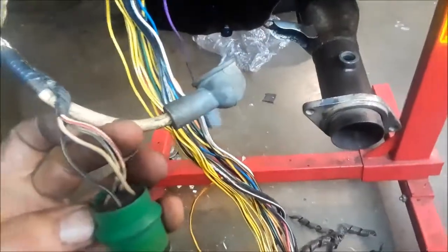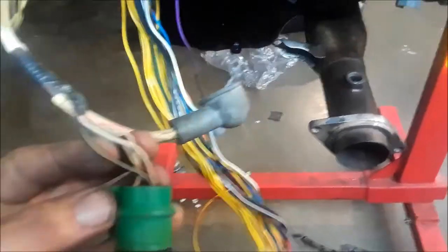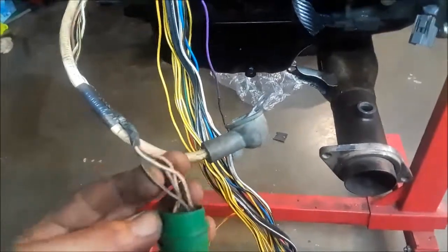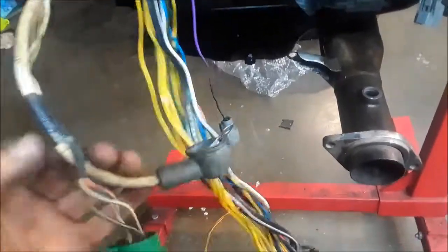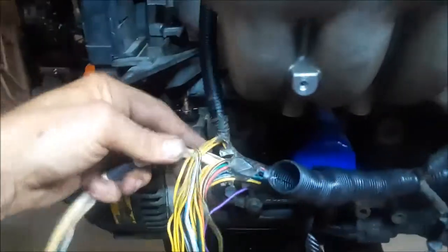You only got the four wires: white, green, white-red, white-blue. And then this black and yellow is your 12-volt keyed-on power source to basically turn on the alternator. Only one black and yellow, all the way up in.